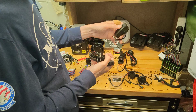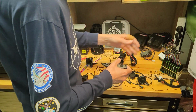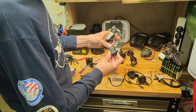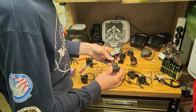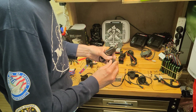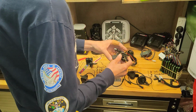These have got a voltage meter on them, but they're always going to read 12 volts because the buck converter is always providing 12 volts. So you don't want a voltage meter. You can get this style without a voltage meter, which is very small in real estate. I use these myself on the Manus, and they're just USB-C. I don't know if there's USB-A, or if there's a Type-C in them, but anyway, they haven't progressed.